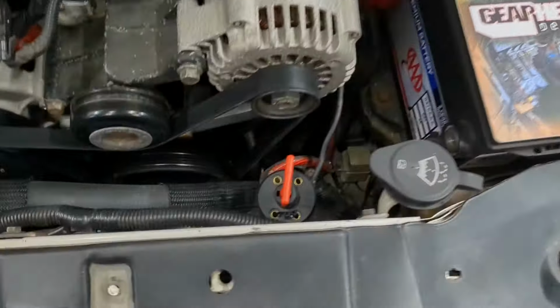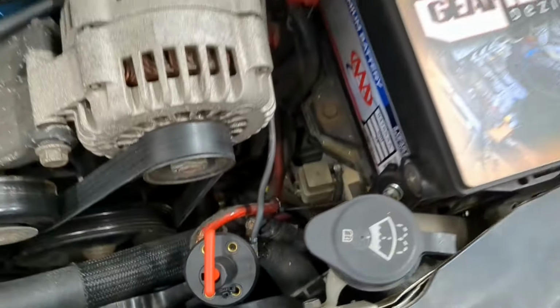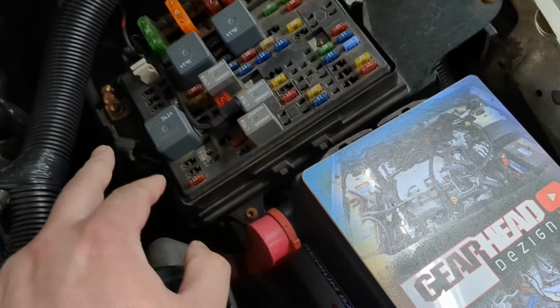Okay, here I am testing out this little kill switch that I rigged up. Right now it's just zip tied in place. I'm probably not going to drive it like this, but the Cletus burnout contest has to have a kill switch that's accessible from outside. I'm going to run with no hood at the burnout contest, so I can keep the kill switch in here. And the GMT 800 fuse block makes it reasonably easy to run.